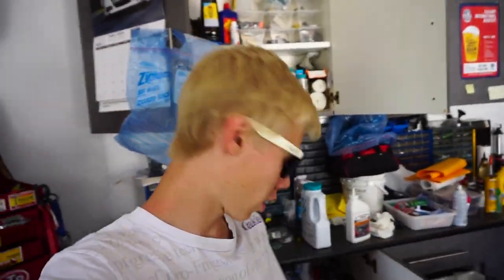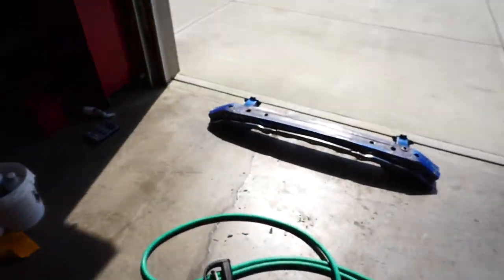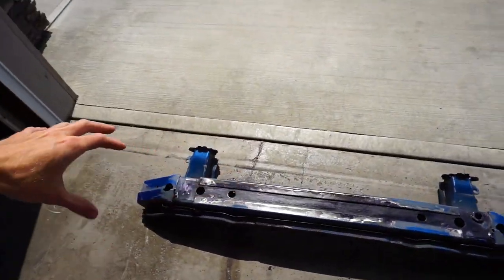It's not even dark primer, which means once you have the bumper skin off you can see it and it's very vibrant - sticks out like a sore thumb. So we'll probably end up just putting a super light coat of our rust paint that we used on the wipers. I'm trying to figure out how to lay the bumper bar out because laying it flat you're gonna miss half of it. I think I'm gonna lay it upright, paint one side, then flip it over and paint the other side. Let's get to priming this.